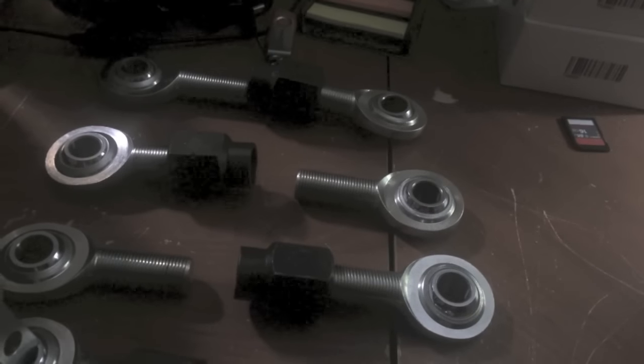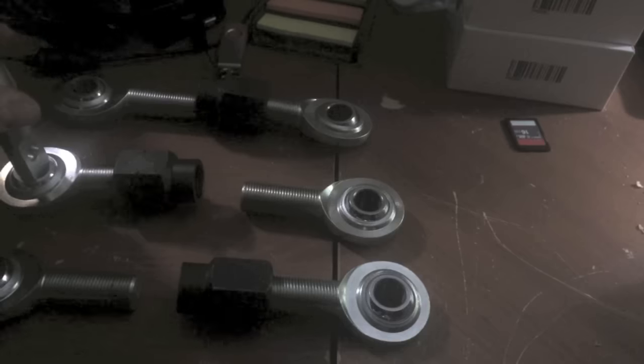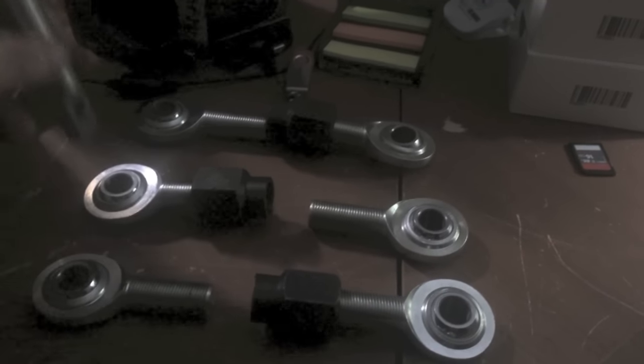One, two there. And then on the other side, it bolts up to the trailing arm. That's the toe arm. Yeah, the toe arm bolts to the trailing arm. And then this one goes to the chassis, and this one goes to the trailing arm. But like the normal, it's just like a working space to make it fit. And yeah, so we got the bushing lubricant, and we'll put that after it. So we're gonna bring that to Wildcard and get that made.